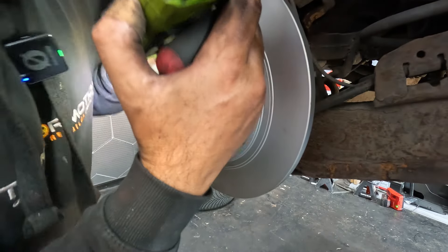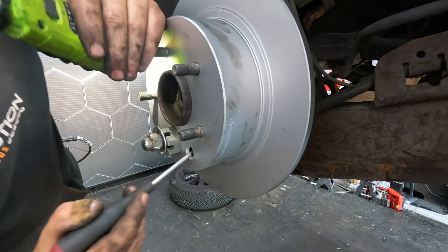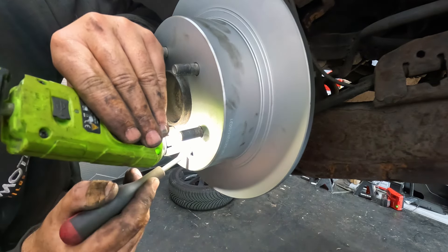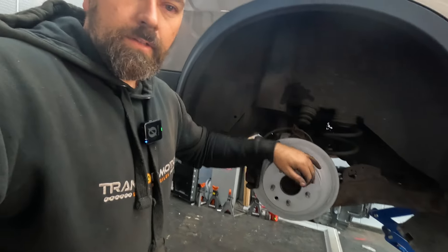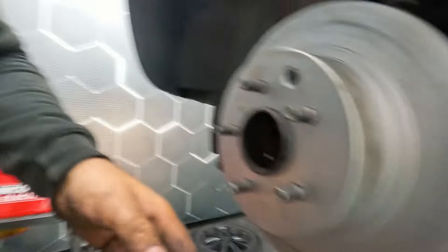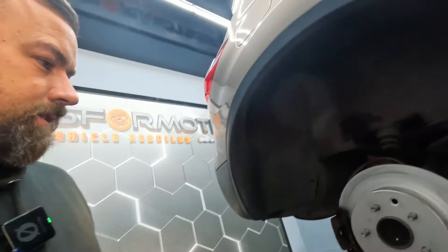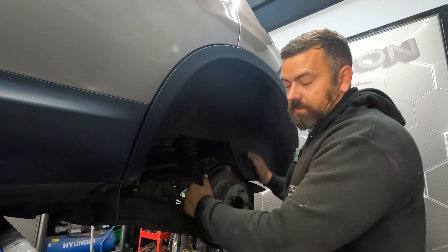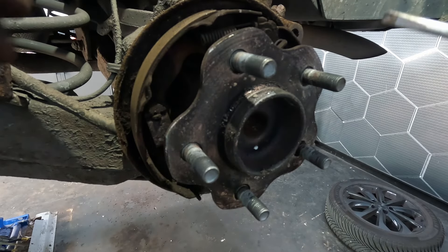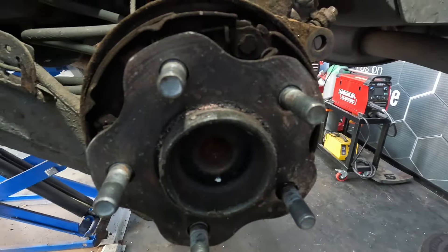It feels like it's gone hard — yep, so that's locked up. Now I'll back it off a little bit. There we go — that's that side done. It's easy enough to turn but there's just enough binding so once the handbrake settles in it'll be lovely. Now for this side I'm not going to show you taking off the caliper again since you've seen that already, but I'll show you close up how I put all the springs and clips back on — there's springs and clips and things everywhere.